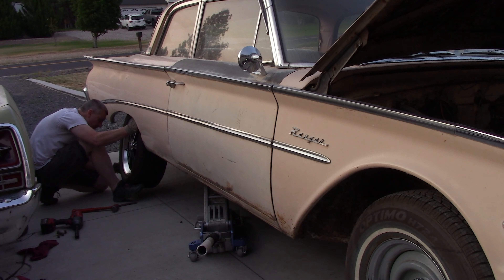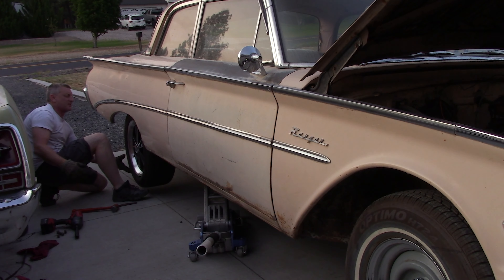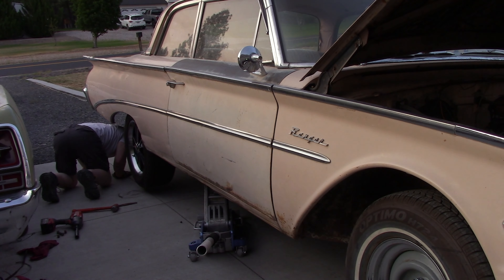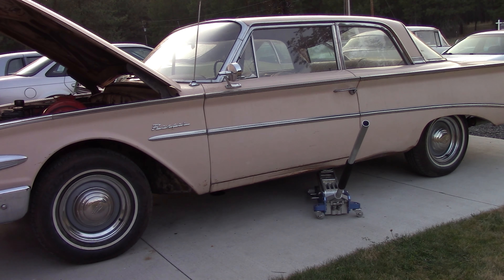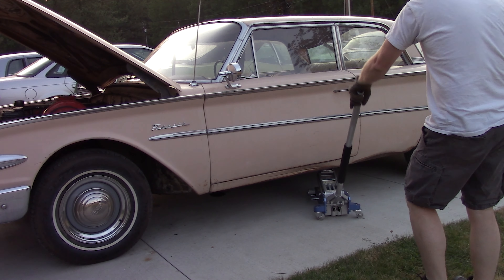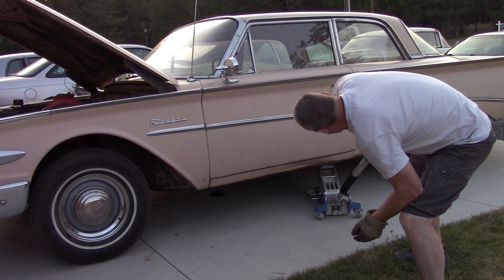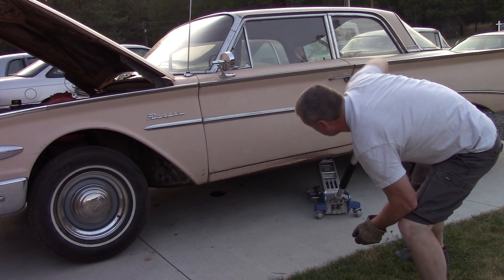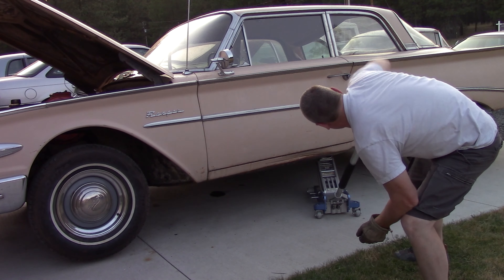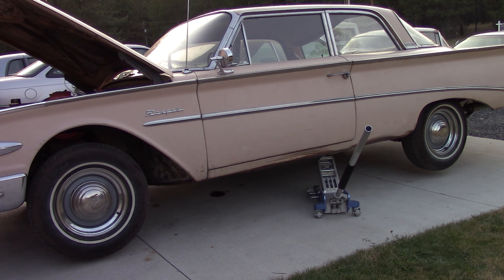I think it's going to fit. On the inside, looking okay clearance-wise. I think it might actually work. Always jack these cars up under the frame, especially if you're putting wheels and tires on the rear, because you won't get them on otherwise — you need that axle to droop down. We'll get both rears done, then jack up the front because we're going to want to take a look at the bearings on the front brakes too.